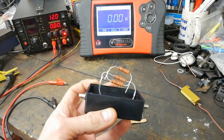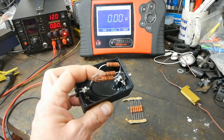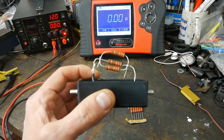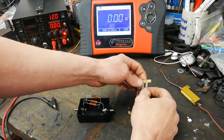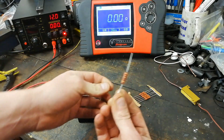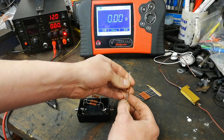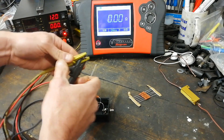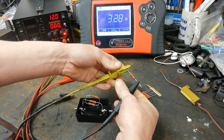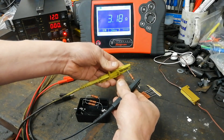You can see three resistors there and they're in parallel. I'll maybe just explain why I've done that. I just did this with bits that I had lying about. One of these resistors — I'll just pull one out — it's quite beefy. The reason for that is these are 3 watts rated, so it's all about the power it can handle. If we measure that, it's 3.18 ohms on that one, 3.2 ohms on that one.